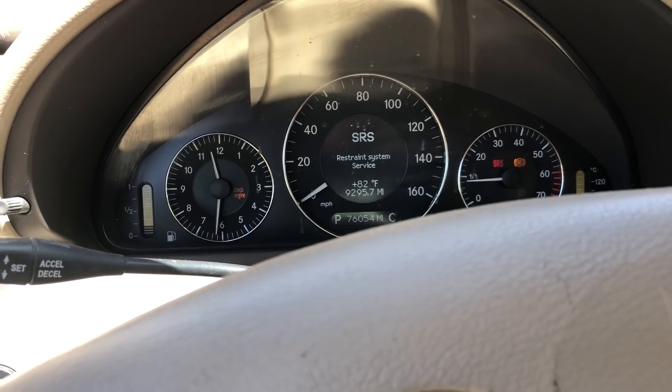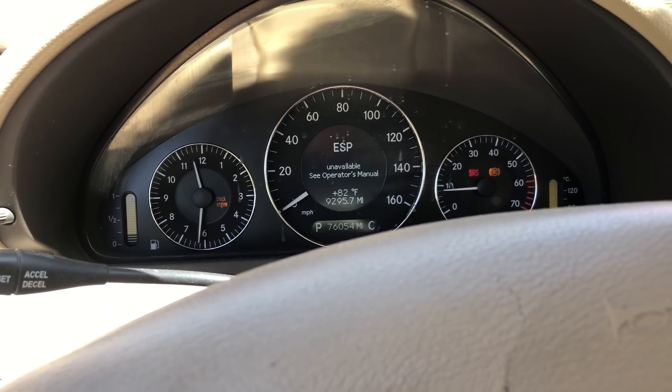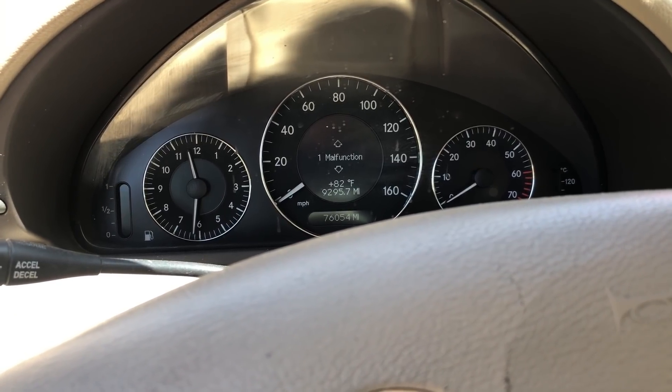Let's summarize what we have learned, students. Turn her off and have a little chit chat. We tried the mass airflow sensor — it kind of helped, but I'm still getting misfires on four, five, and six. The only thing I can think of now: you have the air coming into the engine, maybe it has nowhere to leave the engine. Maybe the catalytic converter is clogged. So what I'm going to do — I'm going to change my shirt because I have to get kind of dirty for this — I'm going to take out the oxygen sensor that's in front of the catalytic converter, start the car, and see if she runs better. Because that little hole will give the exhaust somewhere to go. And if it runs better, then the cat's clogged and I get to buy a new catalytic converter.